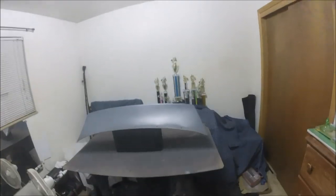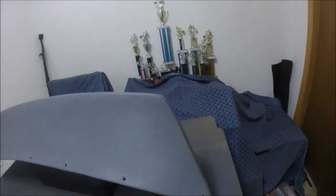Because I remember last time I did this and I painted the bumper. After I got the bumper painted black, I was like, oh man, you still see the scratches everywhere. But as soon as I put the clear coat on there, it just shines so bright. Like you can't see any of the scratches or flaws anymore. So with that being said, bros, let me go ahead and take this 320, go over this thing, give it a nice good scuff, and then we will be ready for paint and clear coat. Okay, this thing is officially sanded, bros. Nice.